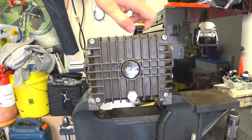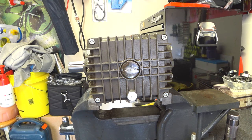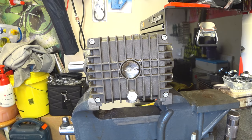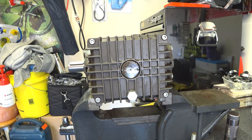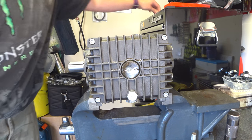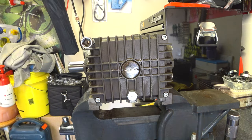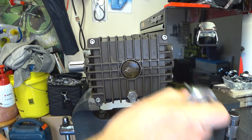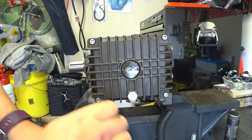Right, quick 180. Let's take this dipstick out - these are the same as the gearbox. Let's have a little sip of coffee, keep yourself hydrated. So again you're going to want to crack off these four bolts. Got my little oil bowl on the floor because I'm pretty certain this is going to spew some oil. These are not going to be six mil, they look like they're going to be five mil.